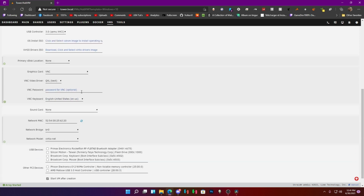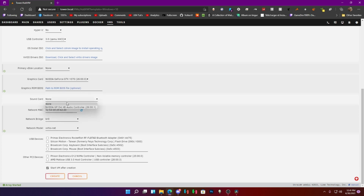Your disk needs to be none. Your graphics card is whatever you inject it. Mine is a 1070. And of course, your host controller here for your USB and the NVMe you chose. Now, as I said, I recommend you grab a SATA card and a USB hub, okay?